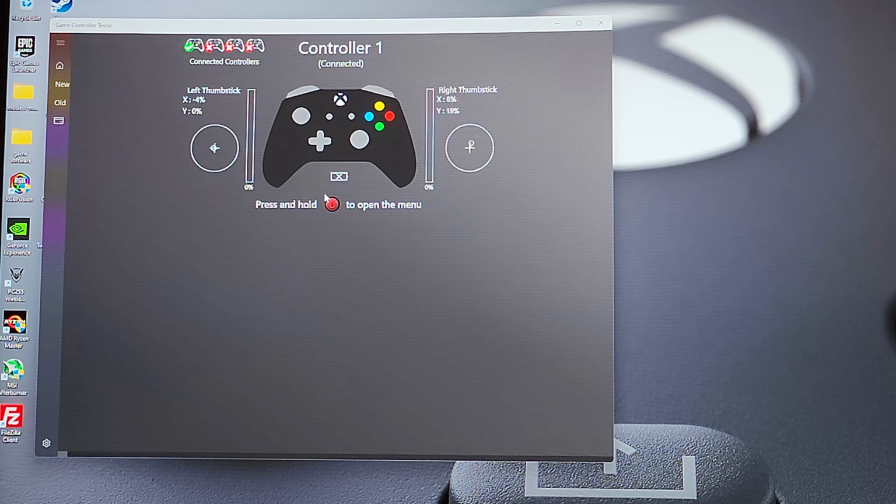So after reassembling and putting the cover back on, the thumbstick was not able to move past 80%. So it was never going to be fully functional, so we did need to go ahead and replace the potentiometer. My guess is that the hair and dirt or whatever was in there just damaged it too much, so cleaning it wasn't going to help. That's the new potentiometer. Go ahead and add some flux on, and then just flood it with new solder.